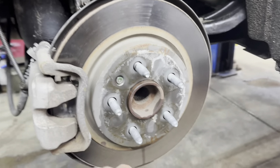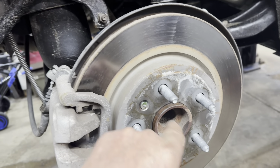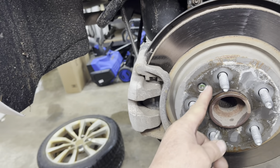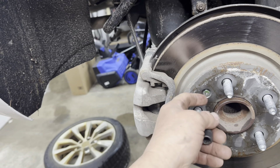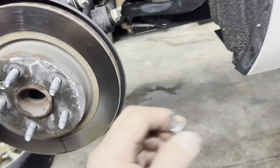Spray down some penetrant, get a T30 Torx and break out this little retainer bolt. Take that bolt out with your T30 bit, snap it off, then get a little chisel and chisel it in the direction you want to remove it. If that doesn't work, get a die grinder and put an X on it, then chisel little pieces out — the X makes it a lot easier to remove.